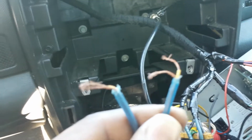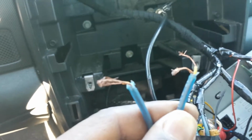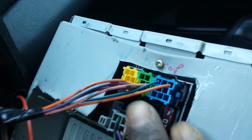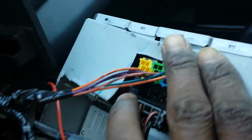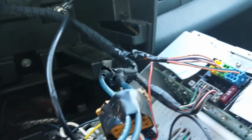It can be hard doing it without actually breaking your wires. What I do is I use a lighter. I burn them off. It leaves all the wires intact. You can get the connection you need. Now what you're gonna do with those is, like I was telling y'all, the middle plug is tan. You gotta remove that middle plug. The other 2 you leave in. This is the middle plug. As you can see, my wire running right here.